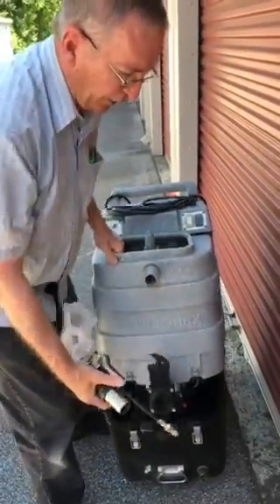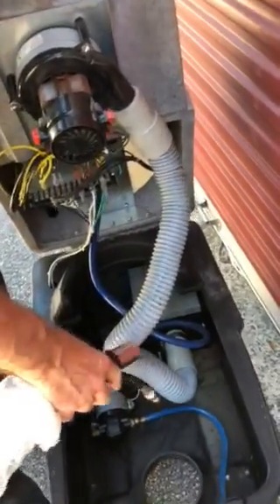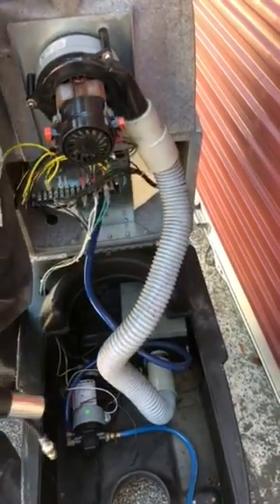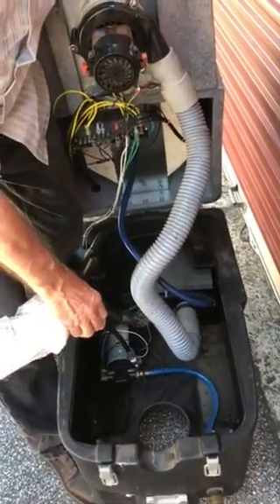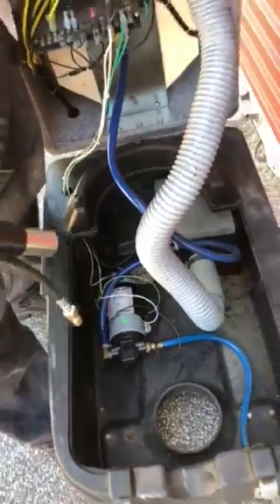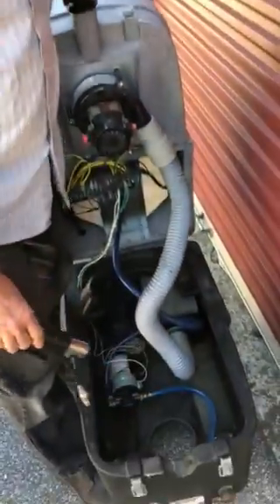Just one other point. When you open this up, you'll see where the pump is and this blue hose. I have actually seen some blue hoses completely clogged with mineral deposits. If you put your nipple in there and it still doesn't work, disconnect this side — the outflow side of the pump. Disconnect that and turn the pump on for just a second. If you get water flow, then that will tell you that this hose needs to be replaced.